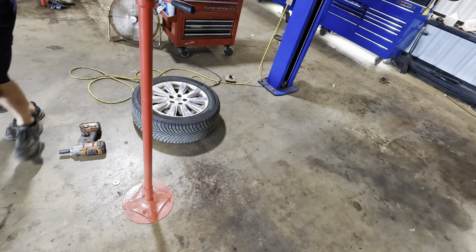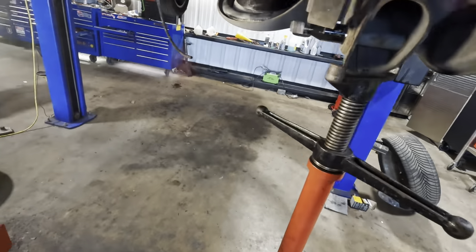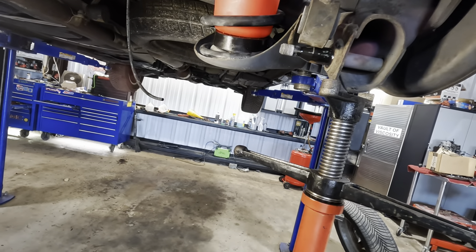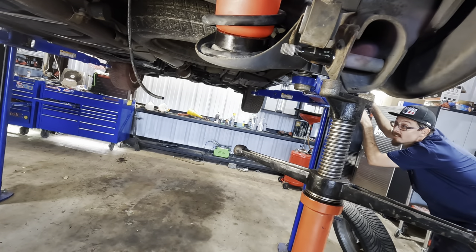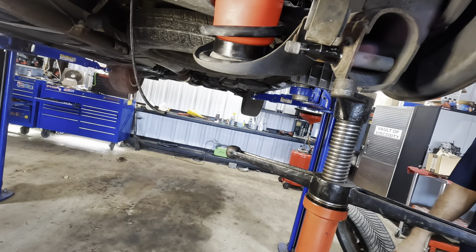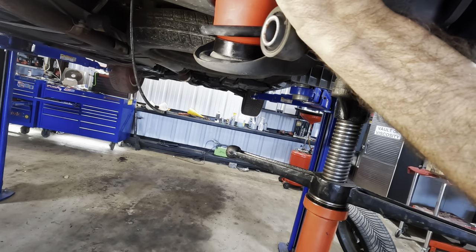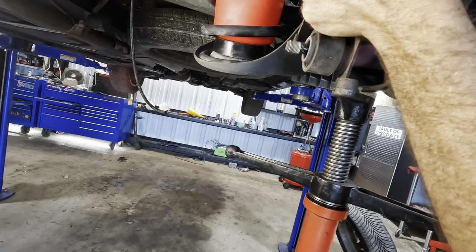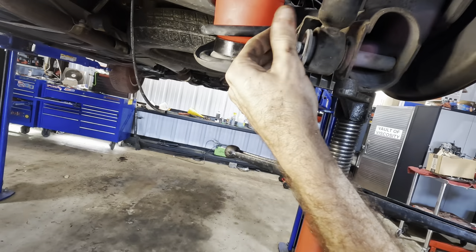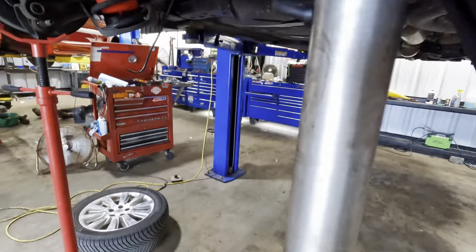We're changing angles and geometry here. If you look at the bottom of the pole jack, it's starting to lean and we're forming a gap on one side because the pole jack is coming over at the top due to the geometric design of this axle. What I need to do is just kick — or rather hammer — that guy over and make it fit. You do this kind of thing incrementally; you're not making super large adjustments. A couple more bangs with the mallet on the pole jack, and the other side requires similar treatment.